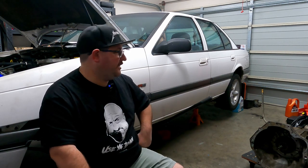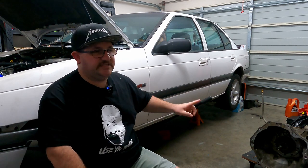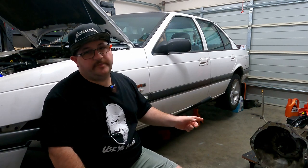So the BTR in this car is a 91 LE, and this gearbox here is a 93 LE. They have different pumps, and therefore the impeller hub on the torque converter is a different length. I did measure the setback, and it wasn't a large enough gap, but I just tried to bolt it in and send it anyway. Unfortunately, I can't. The flex plate is hard up against that torque converter, and I can't spin anything to line up the holes.